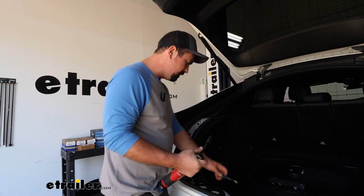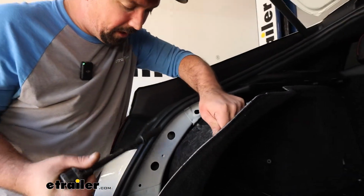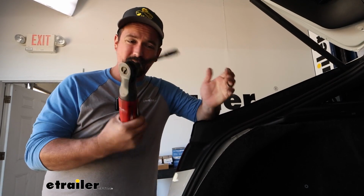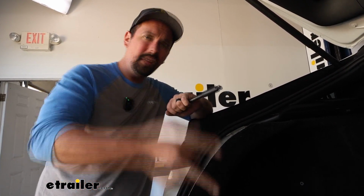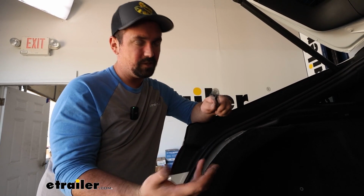So what I recommend doing is, you'll see these spots here. These are where we're going to get the first two. It's a stud that's fairly long, but the end is tapered. So if you loosen it up, I'm going to swap over to a ratchet and just use a hand tool here. And once you get to that tail end, if you're very gentle and pull that out and you have a magnet handy to get that, it's the safest way.